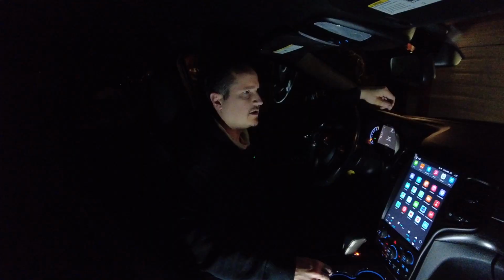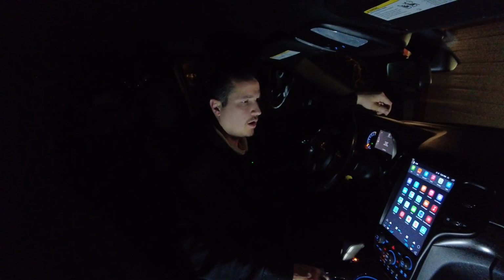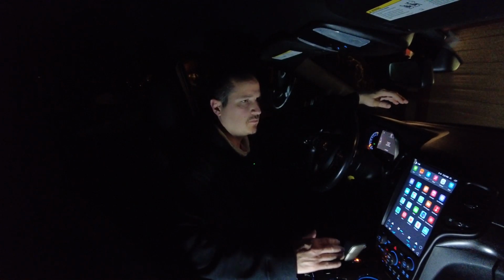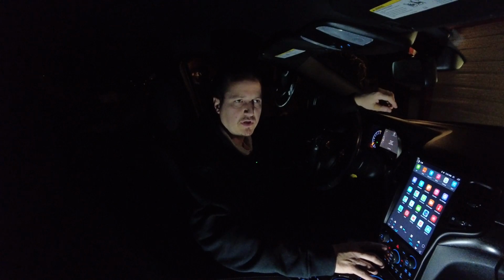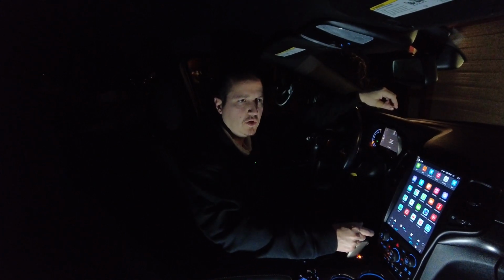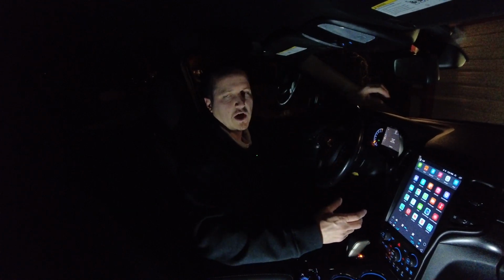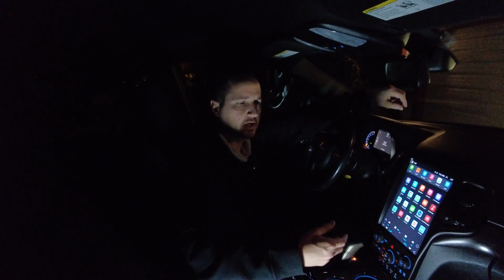But yeah, where I ended the video, it was becoming frustrating. But all I really did, you saw how I split that climate control mounting bracket in half. I took the lower half and inserted it into the dash with those 2 guiding pins and fastened in the 2 little screws, and then took the tablet. So actually then I had to take the vents out of the old bezel, which really wasn't that difficult, but it wasn't easy either, but I got it done in a few minutes.